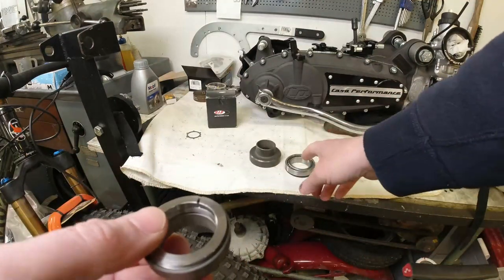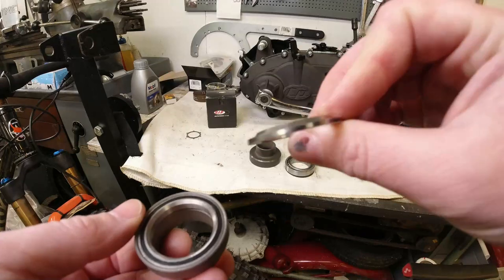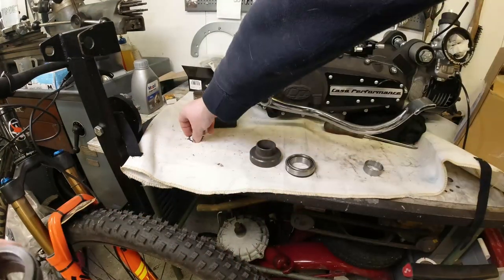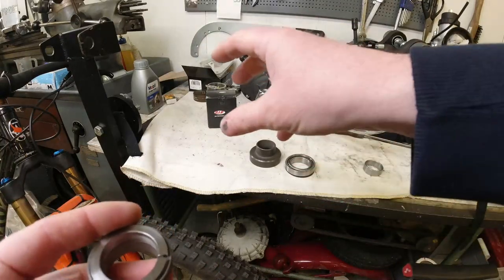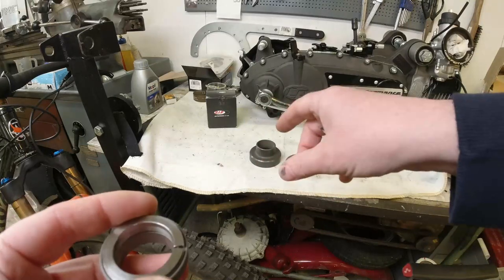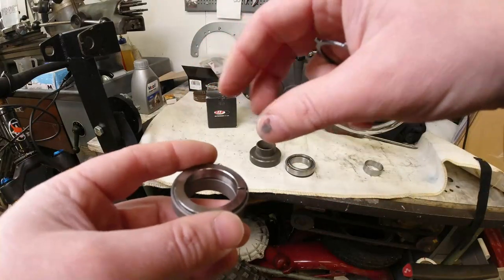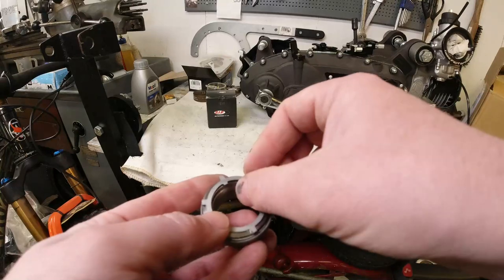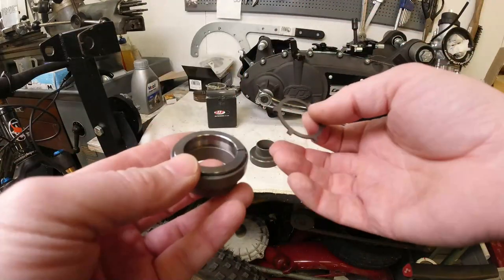The fact that it's got a taper roller at the bottom and this little shim at the top, which has got a chamfer on the edge, will centralize the fork into the frame a lot better. SIP also supply this because the SIP bearing is two and a half millimeters taller than the standard setup. So what you have to do is lose one of your tightening nuts on the top — just use one of them and use this tab washer. Once you've tightened it down, you fold the tab up and that should keep it secure. Now this is just a guess, obviously, because SIP don't give fitting instructions.